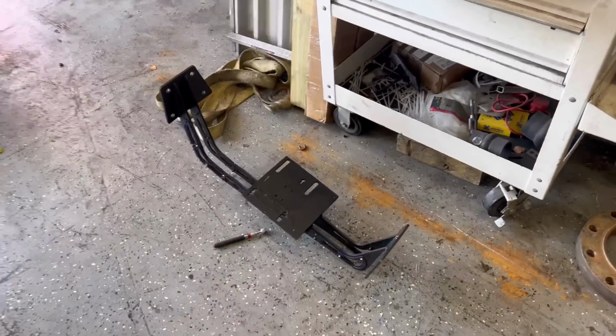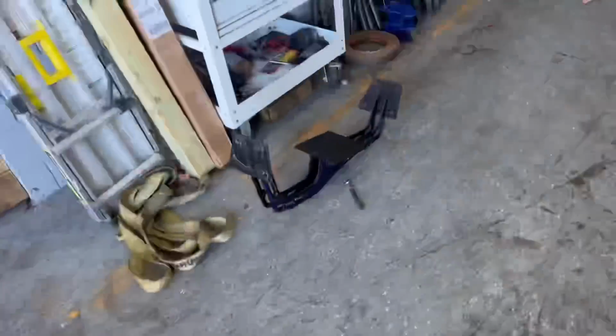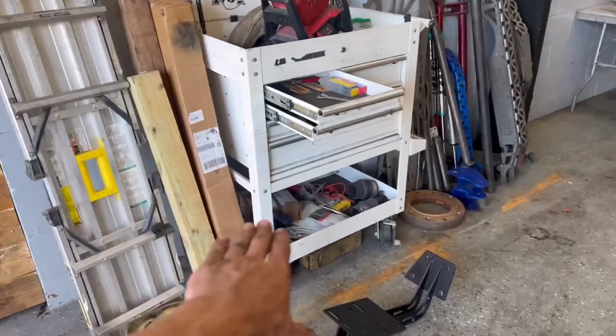I have a cross member right here that's been laying around, a custom CNC built cross member that I welded up for the blue truck, which is now outside, and we'll talk about that one in the next video. But we're gonna throw this 4-wheel drive trans cross member in now because it's the same bolt pattern as the 2-wheel drive one, just the one for the 2-wheel drive doesn't have this loop inside of it. So it'll be nice straight down and across flat.